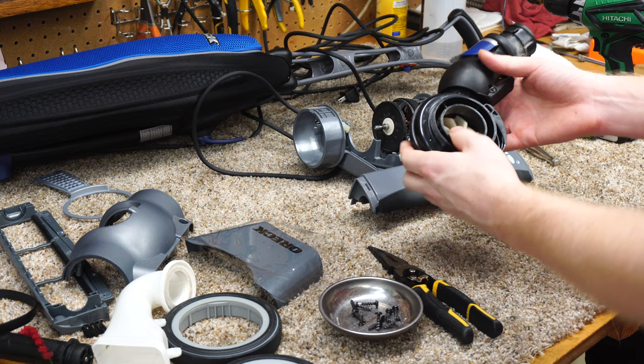These covers are questionable — you're only going to put one of them on, and I'll explain that in just a second. The side without the belt just goes on, and just like I showed earlier with the needle-nose vice grips, we lock it into place. Now, some shops and some people might be unfamiliar with how to clean hair and debris off a brush roller, but we use a wire wheel on slow and just touch the tip of the bristle on there. You should not be removing any paint from the roller when you do this. Really simple — and it looks brand new.